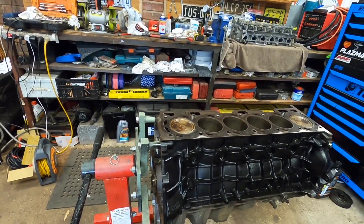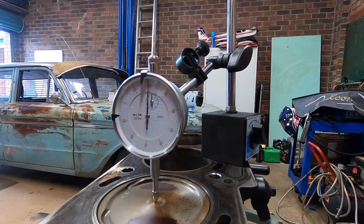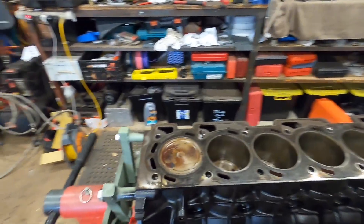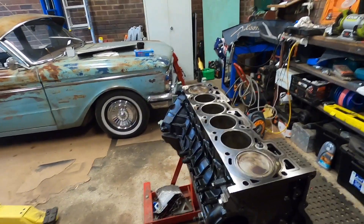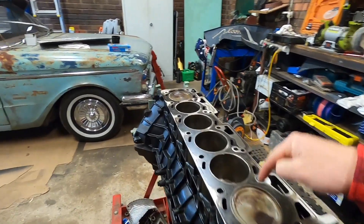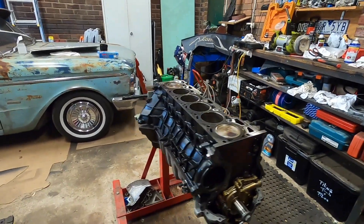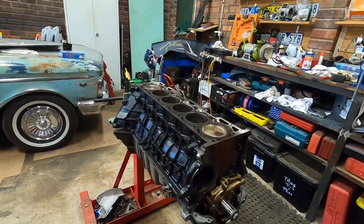Today's the day we slap the barra back together. Just did a quick time lapse of checking the piston heights, just to make sure we haven't got a bent rod. The FG turbos or BF — I think it's around '06 — have the thicker conrods. I went across and measured all the piston tops just to make sure they're within spec of each other, so nothing is down a hole. I'll flip the engine over and plastigauge the clearance on the bottom end bearings and inspect them for wear.